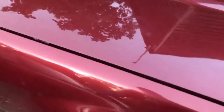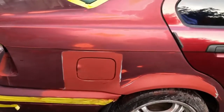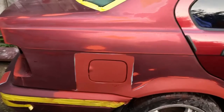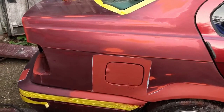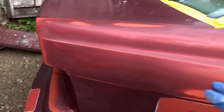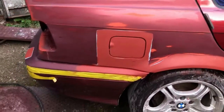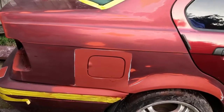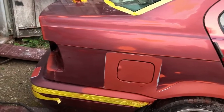At some point it'll match the bonnet since I did the bonnet. That's where we are at the moment and I think this is ready for paint. I know it looks a little bit dramatic — all different colours everywhere — but as long as you rub down everything that you're gonna spray, just make the surface rough basically, then you're allowing the new paint to stick to it. That's my main purpose; I don't want it to peel off in a few years. The car will most likely outlive me, and hopefully I can finish it before that happens and enjoy it a little bit.